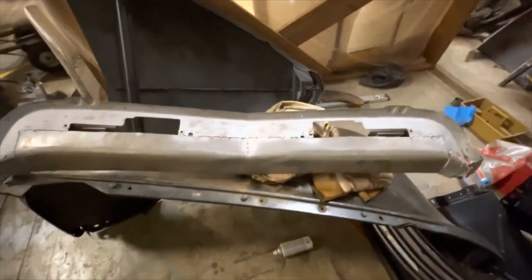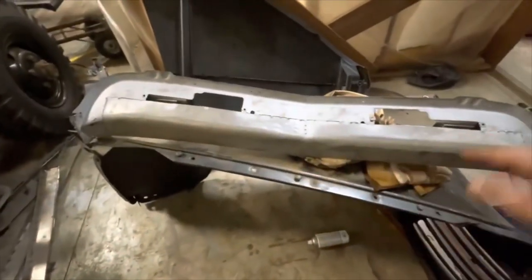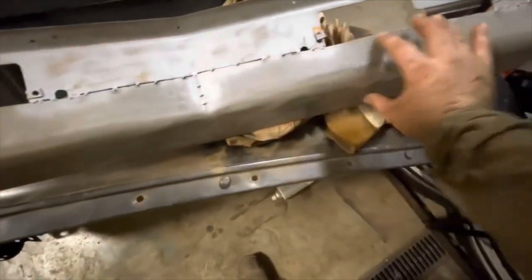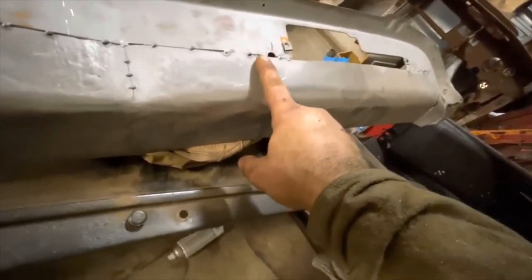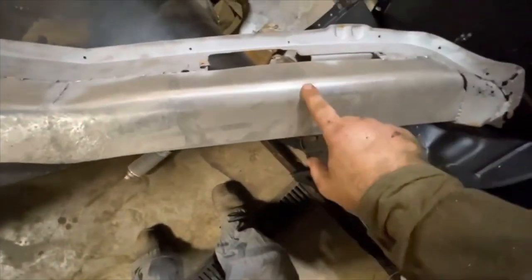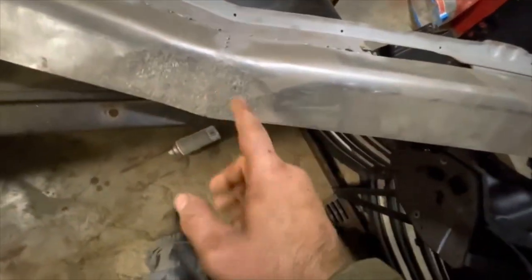This piece kind of marks my first foray into metal forming. This is the part that sits just above the windshield inside the cab — headliner attaches to the top right there. This piece was completely rotten out all the way across. If you look at it from a manufacturing standpoint, you've got a flat piece that's sort of rolled over. But this thing is somewhat V-shaped — it's got two angles. So in order to achieve this angle, first I rolled this edge in my brake on a nice long flat piece, four feet wide, and then I stretched this whole area just with a hammer.